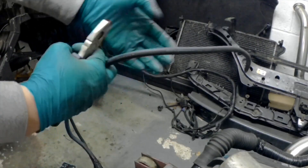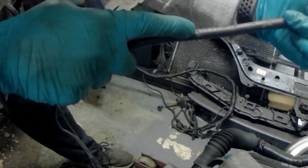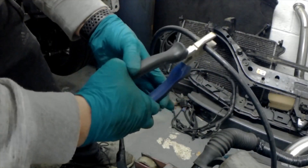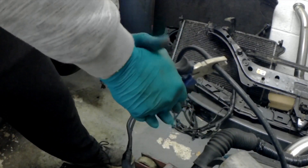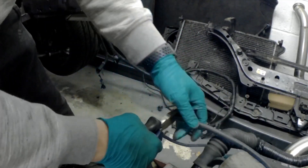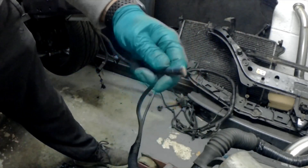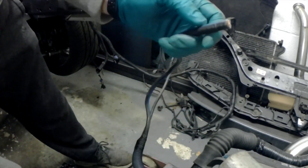I've also made a mark in the starter cable right about there when the engine was back in, so I know I need to cut it there. That's what I'm going to do now while it's out — always give yourself a bit. Now I can strip the ends of this and put a crimp on the end so it can be crimped into the car.